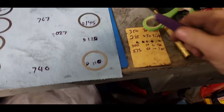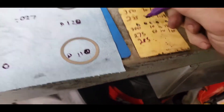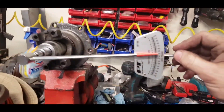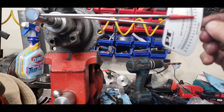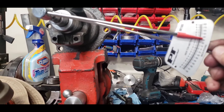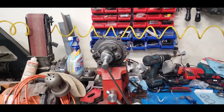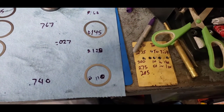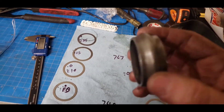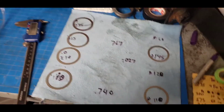The winning number was 285 thousandths. Thank God. We've got a running torque right there at 35 inch-pounds — right at the top of spec. I'll take it. That's ridiculous — what a freaking pain. But I won't ever have to deal with these crush washers again. Woo-hoo! Awesome. Thank you.